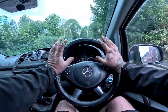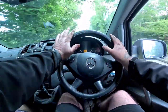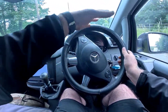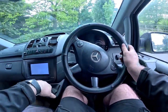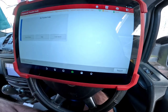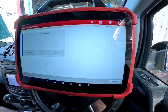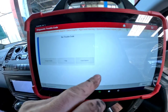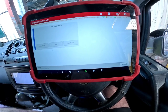Now we're out on the road. What you need to remember when test driving a vehicle is to try and drive it as the customer would drive it, because your driving style is not going to match theirs and the vehicle will perform differently. Back in the workshop, I've gone through all the live data — fill level, back pressure, exhaust temperature — everything is as it should be and we've got no fault codes. I'm closing this one as a successful diagnosis and repair of a Mercedes Vito.